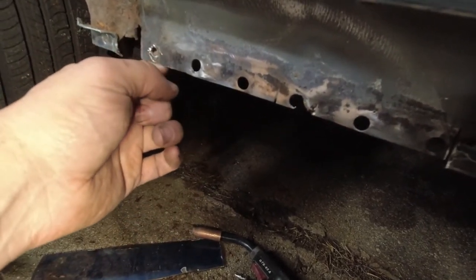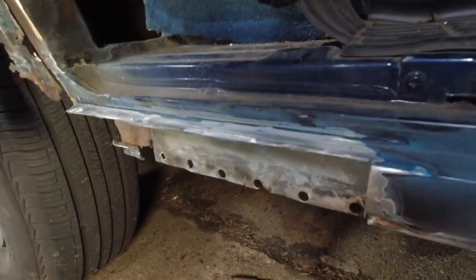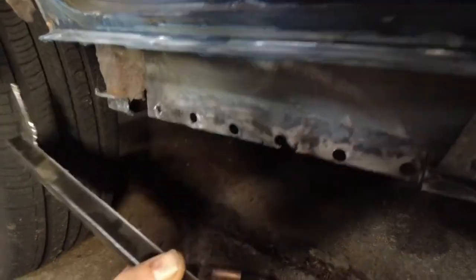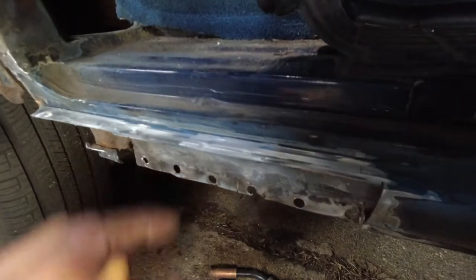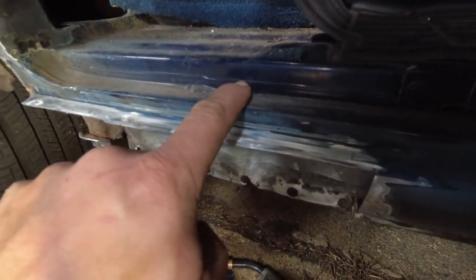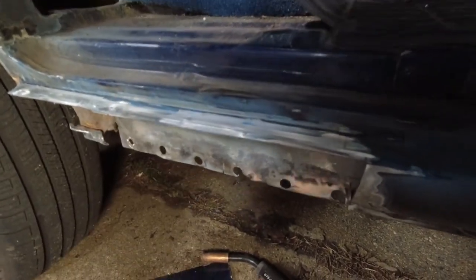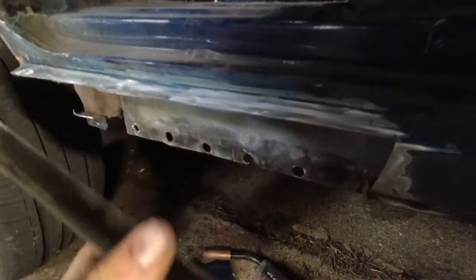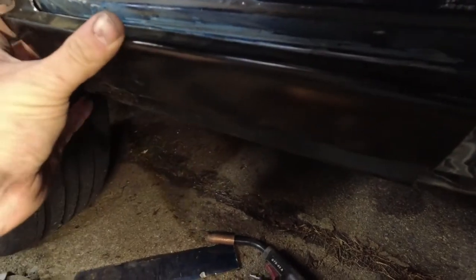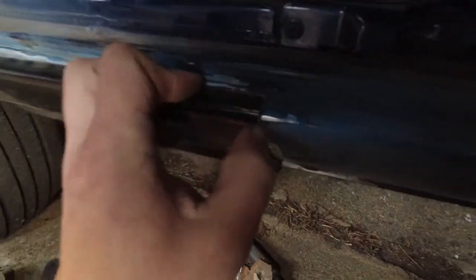So what I've also done is taken the replacement rocker panel and cut this piece out of it, which is shortened, and then took the lip off because this piece actually, the original piece runs up to here. There's actually a seam sealer where it would, so I think these overlap. Yeah, it overlaps up here and there's some seam sealer there. But I don't need to go that far up, so I'm not gonna, because it, again, keeps everything reference-wise as straight as possible.